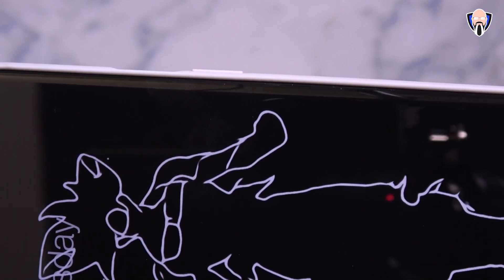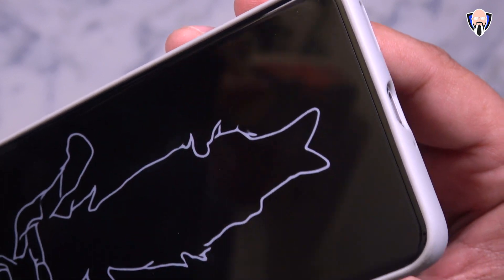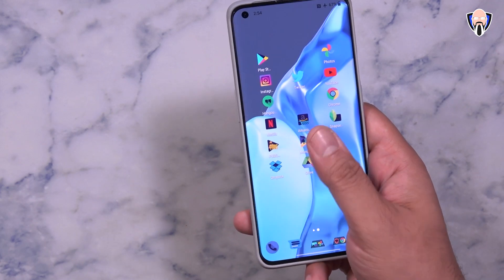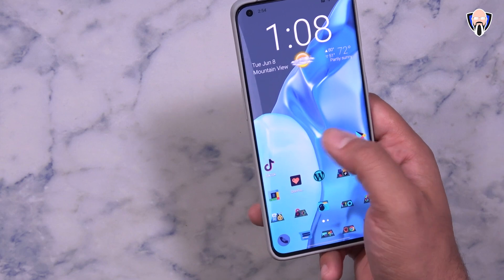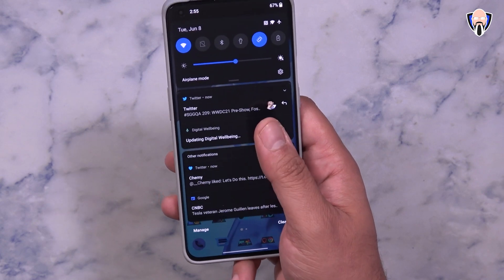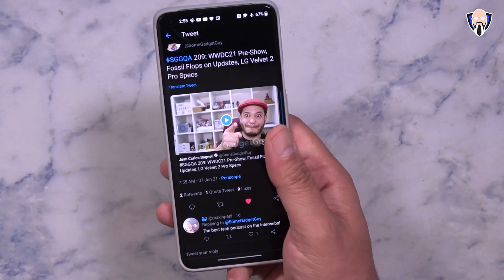I've used dome glass for many years, primarily on my Samsung devices, my OnePlus devices and all of the other devices they carry. The main thing I'd always say is make sure you're in a clean, level environment, because when you release the adhesive at the top, you want to bring it into the center. For the most part, all of their installation kits — with the exception of the S21 Ultra, which was the only mechanical one I've seen — it's pretty simple. You just release it, allow the adhesive to go through, clean it off, run the UV light and you're set. It works really nicely on my OnePlus 9 Pro and now with the case, it has nice protection on the back for both the case and the camera elements, as well as the glass on the front.